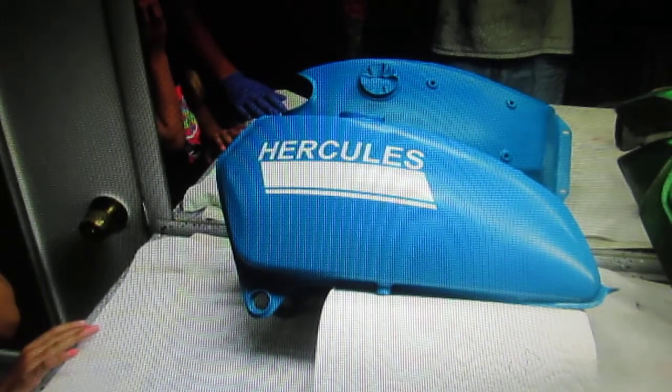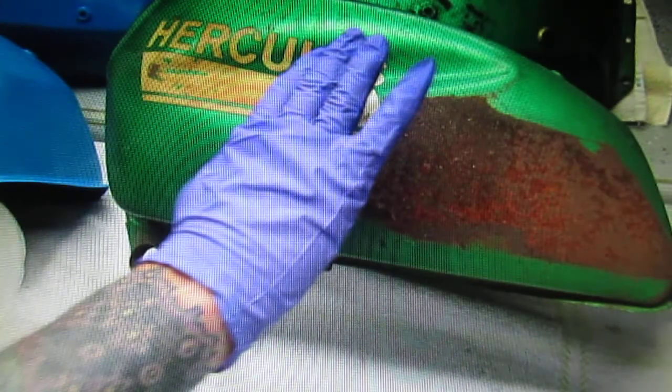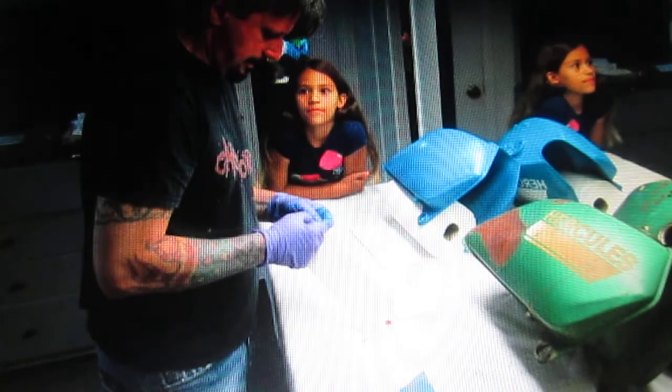And we kind of did this all by eye. It was good having the extra tank. And just as a note, if you were going to restore this tank, this would have to be all stripped. Where it's rusted, this has to go down to bare metal. If you paint over rust, guaranteed that job is not going to last that long. And then bubbles are going to appear.